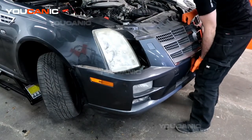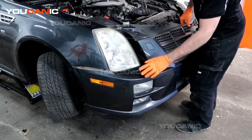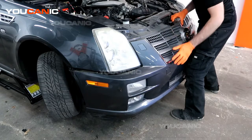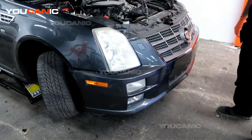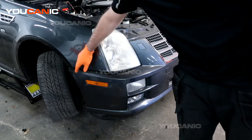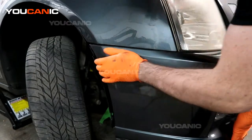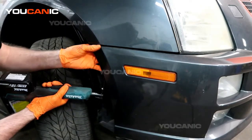This is where you're making sure you get the wiper fluid actuators in where they need to go. Slide this up there. Do everything to basically get it to sit and line up, and use some screwdrivers to hold this up temporarily on the front while you come around this side and get the bolt up in the channel, slide it forward, and then put the screw in to hold it on. Make sure we get this to go up — there's a little open indent and then we slide it back into place. We've got our number 10 bolt started and we'll tighten it up.